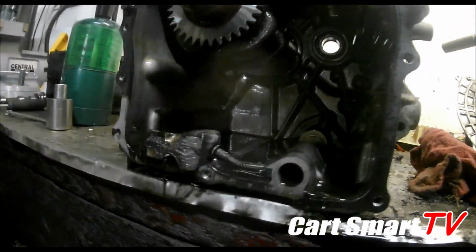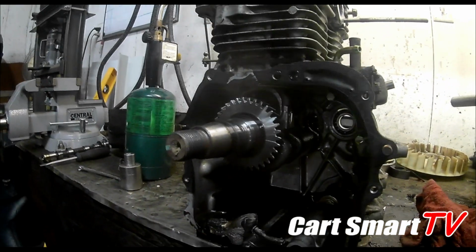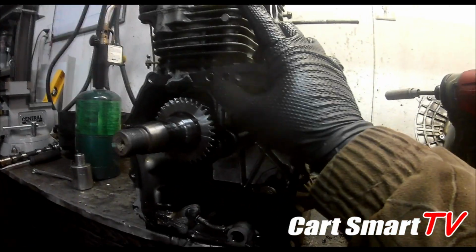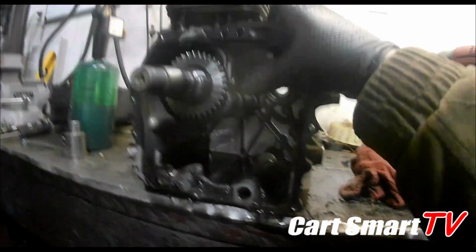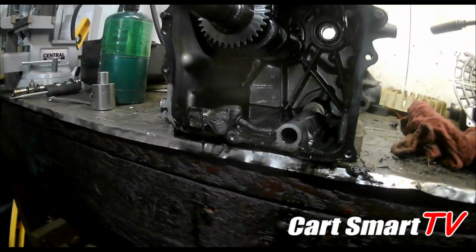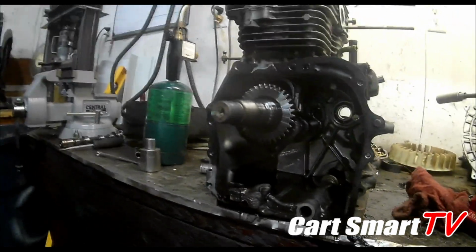So looks like we'll be replacing a rod. We're going to go ahead and replace piston rings too. We normally always do that after we do the teardown, unless it's valves. If we find a motor that's had a valve issue in the cylinder head and it still had good compression, a lot of times we won't mess with the bottom end, because it's still healthy. No point in messing with something that's healthy. We'll replace the valves, put it back on, good to go. So we're gonna get this thing finished, torn down, and when I get the cylinder head off, if I find something kind of crazy in there, I'll show you guys that too. But otherwise, you'll see a fresh built healthy motor after this.